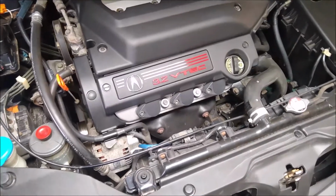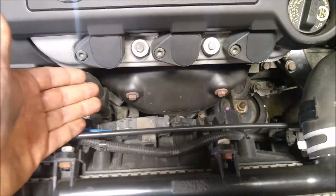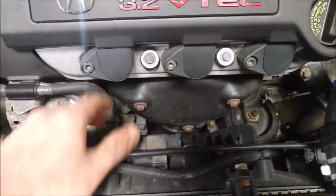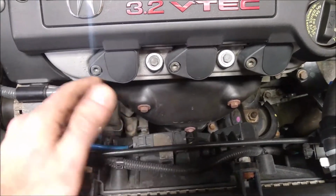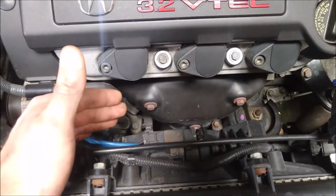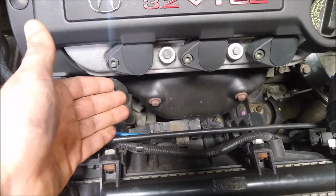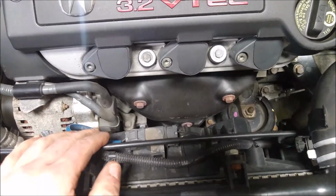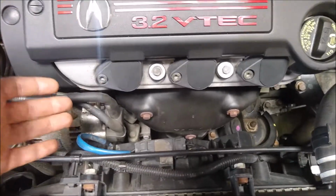and give a review. So here we have the OEM setup. As you can see here, there is a heat shield that goes over the OEM, which is 3 bolts, and in my case they're all rusted, so they stand out. In a previous work, I went ahead and painted this. This is traditionally aluminum with a shine to it from the factory. Since mine was rusted pretty severely, I went ahead and opted for a black heat-resistant paint. But we will have to remove this as well as the backside and the downpipe, or what they call the J pipe.